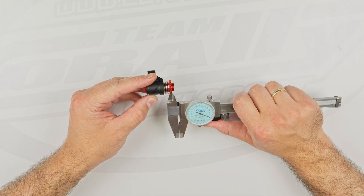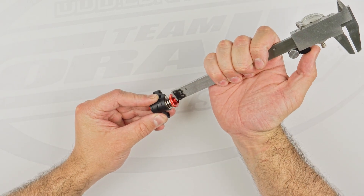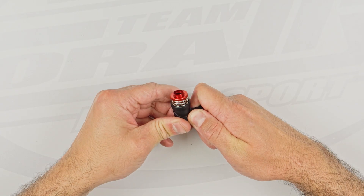Let's stop here a little bit — that's the servo saver. You need to be extra careful here because you want this part to keep clean and always working, because it saves your servo from damage. The stock setup is something around three millimeters from the bottom to the top of the nut. Here you can see the servo saver working, and this small amount prevents your servo from breaking. Keep this part clean to be sure you won't break any servo again.